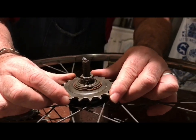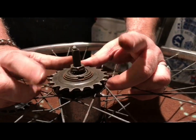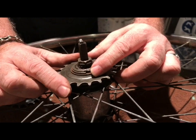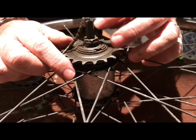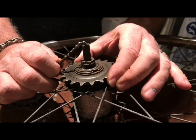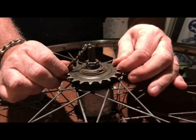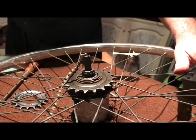Final check - there's a tiny bit of movement on there, which is absolutely fine. If it's rattling around excessively you need another spacer; that's often responsible for a clattering rattle when freewheeling. A small amount of play is perfectly permissible. Job done! Feel free to share this as widely as you want. I'll be back very soon with more of the wheel rebuilds on Project Dawn.